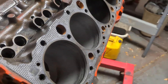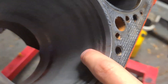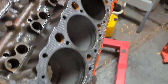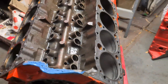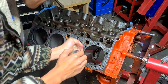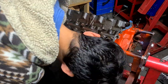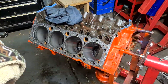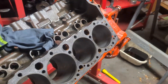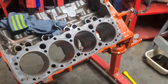I've done a couple of them here and I can see the usual low there, the ridge there. But you can't really catch a finger on it so I think it should be okay. This one seems a bit more aggressive than the other ones, but we'll just work our way through all the cylinders with the hone and see how everything turns out. It's a couple passes — less than ideal but I don't have heaps of money to spend on this thing. We'll continue on.